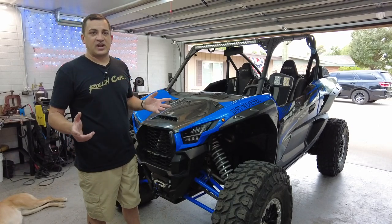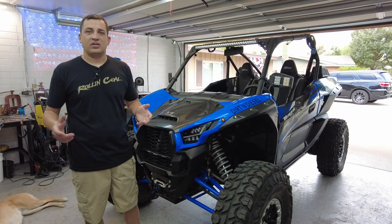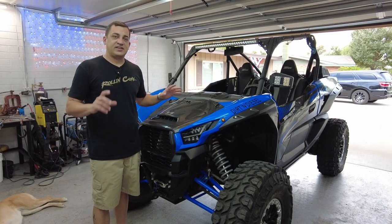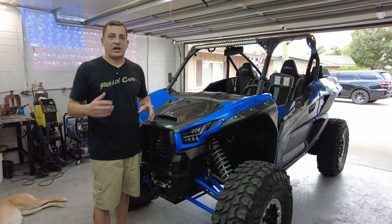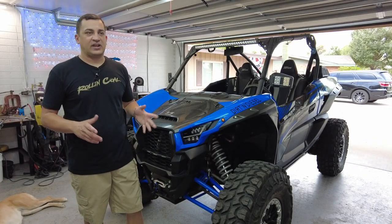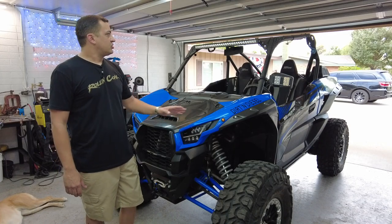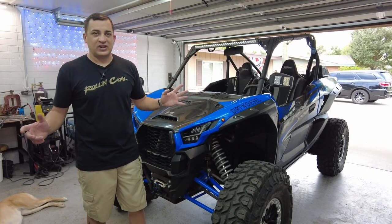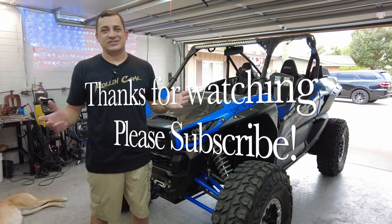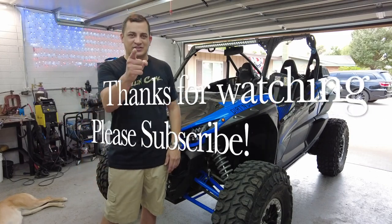The Vox switch was phenomenal — I really like all the features it has, and like I said, it sat out in the rain with no ill effects. Current setup is pretty good. I still need to play with the shock stiffness all the way around depending on my driving style, but I've got the ride height set just perfect: 16 inches in the front, and the tender springs have only settled maybe a quarter of an inch. I hope you liked the video and learned a little something. The worst thing that happened was the self-clearancing, and honestly if that's all that happened over a weekend of riding, I did pretty good. Don't forget to like, share, subscribe — until next time.